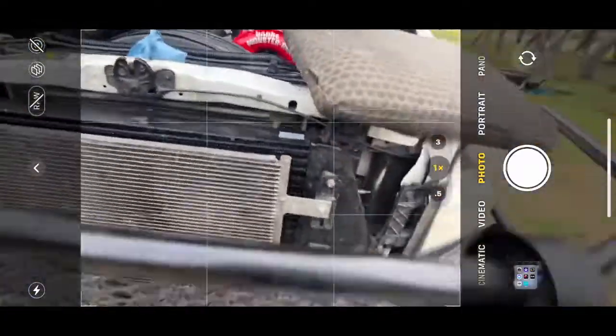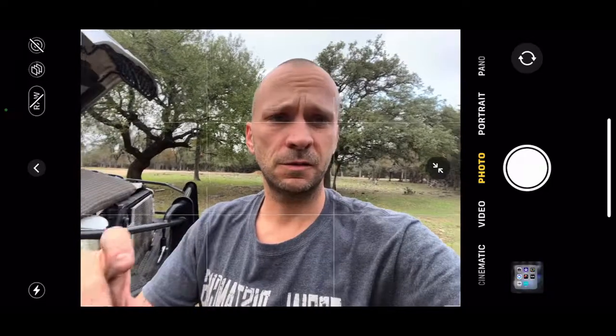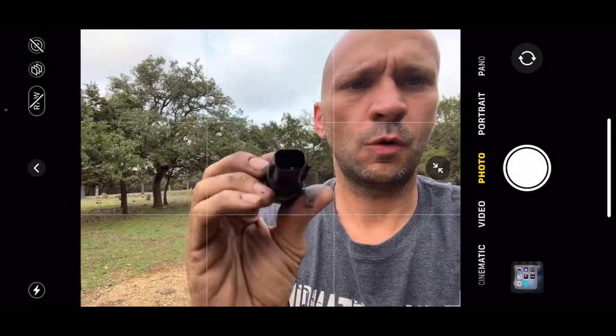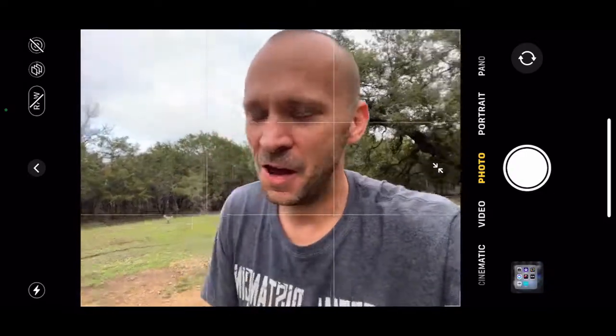All in all it took me about five minutes because I took some brake cleaner — the electrical connector was full of oil. I'm assuming that when this sensor failed, it failed internally and started shooting oil out through where the connector was. That's why my sensor was going haywire and jumping like I wasn't getting oil pressure. But we all know that the Cummins has a mechanical drive oil pump, so if you're not leaking oil, you've got oil pressure.